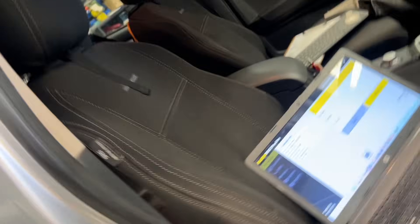So that file's all been written in. On this one we use KESS - it just plugs into its own machine and into the OBD port. You get asked a lot: what program do you use, what software do you use? So the difference between this and my petrol tuning - Haltech and Link and all that sort of stuff - there's no live tuning. This is all: tune it, adjust it, load it, try it, see how it goes. We obviously have a bit of a base map where we know where we can go with these. And then if there's any adjustments needed - such as injectors, turbos, intercoolers, exhaust systems, airboxes, any of those things that change - then we have to obviously change that. It could be three runs, it could be 10 runs. We take a calculated change and go: okay, we've seen this amount of boost, let's change it by this percentage and run it out and see how it goes. We graph it on the dyno, we can log it all into our software and then manipulate the change to make that in the system and load the file in. So let's get it unplugged, get it ready to go on the dyno, let it warm back up and run it up.